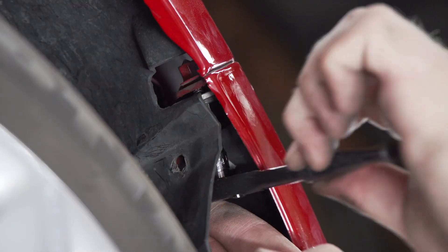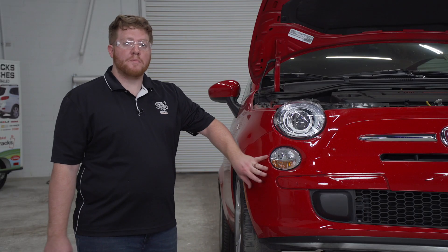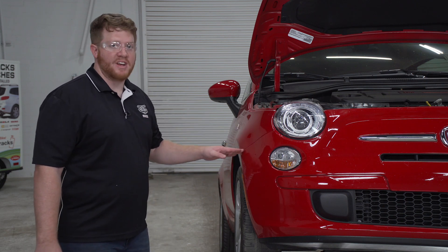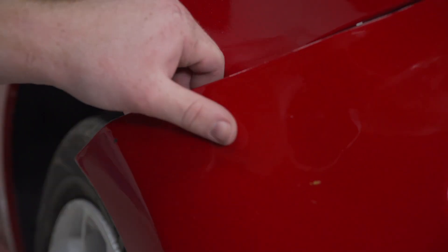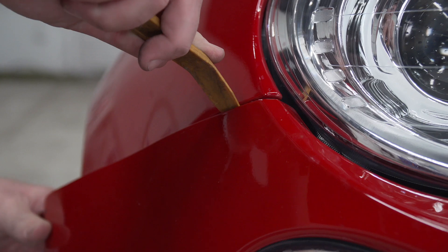It's kind of hard to see but it's right here at the end of our front bumper fascia, and then we'll repeat that on the driver side. Now with all of our screws out we're ready to remove our bumper fascia. We're going to start on the top right here on the passenger side and just pull lightly on the corner. If one of your tabs gets stuck on your fascia — like ours is next to our headlight — we'll take a trim panel removal tool and just push down on the tab inside to release it.